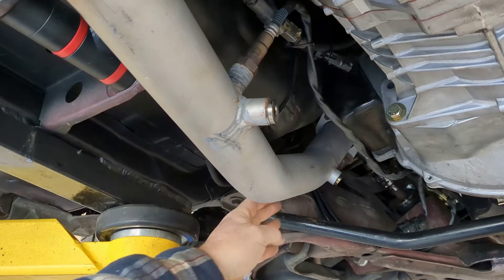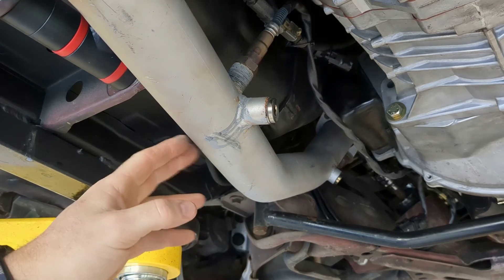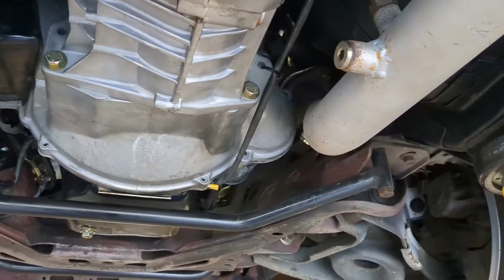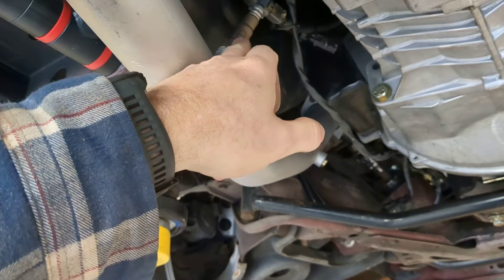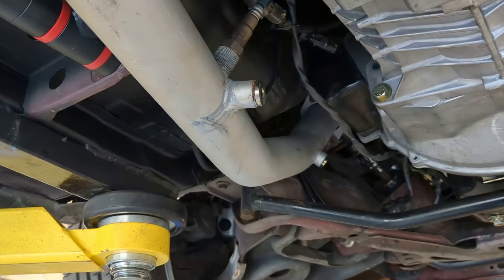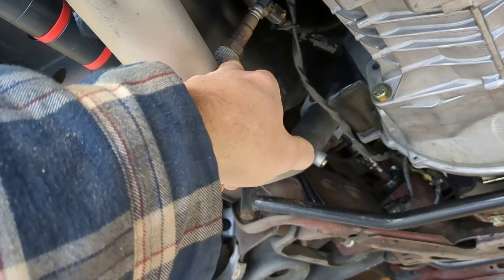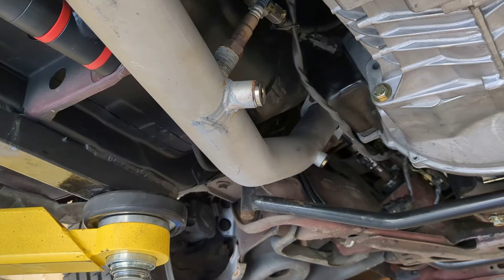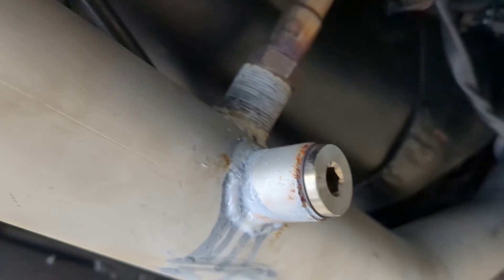On the driver's side, the outside bend is oriented so all the moisture gets pressed to the opposite side of where the O2 sensor is — which is why that sensor lasted. That explains the passenger side failures. So I moved my O2 sensor as vertical as possible, as close to the 12 o'clock position as I comfortably could while still being able to change the sensors. The key takeaway: place your O2 sensor as vertical as possible and as close to the inside of a bend as possible, within 18 to 24 inches from your collector — mine sits about 20 inches out.